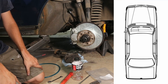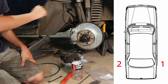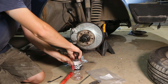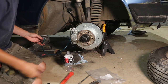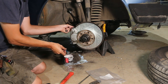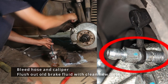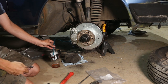What we want to do under normal conditions is bleed the furthest wheel first: the right rear wheel, then the left rear wheel, then the right front wheel, then the left front wheel. That's how you bleed brakes so that you end up with all the air out in the most easy way possible. I've already got this wheel off, which makes it easy to demonstrate the process. We're going to open this bleeder and basically just let the air flow out, doing that at all four corners of the car until everything is flushed out.